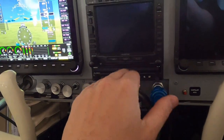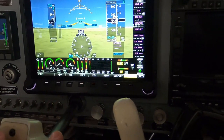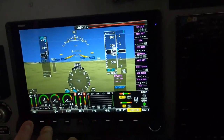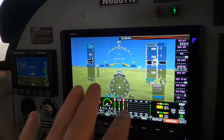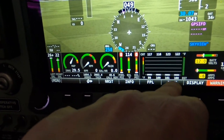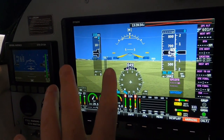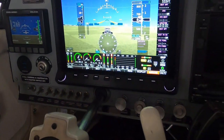I put the radio master on. The Avidyne IFD 540 comes on, radios come on, the audio panel comes on, and of course this side comes on. The reason why this side is on and the others are off is because when you start the airplane you don't want all this on. You put the master on and you have this on. It's wired differently — you need the engine monitoring to start your airplane. Obviously the radios — you don't want a surge of electricity hitting the radios. When the plane starts, I hit the radio master and that'll all work. So we're all updated.